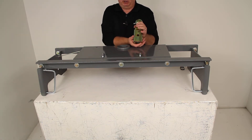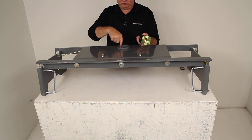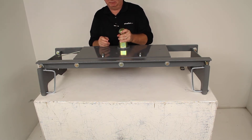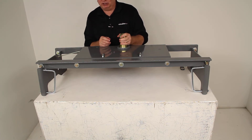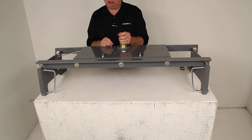The gooseneck turnover ball itself is a single piece machine ball socket that provides rugged durability. It has a square ball base, as you can see here, and also a square ball hole that it sits into. The reason it's square is so that when you drop it into place, the square design will keep the ball from turning in the hitch during hookup.